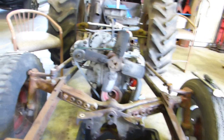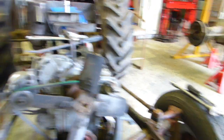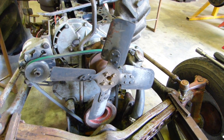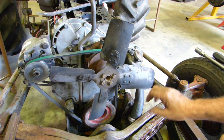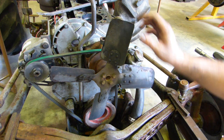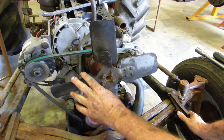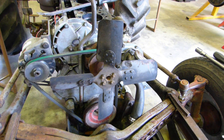Well that brings us into the water pump. We'll come in a bit closer here and try to line you up a bit better. Now this water pump has a couple of lock tabs folded over here to hold the fan on, and it's a trapezoid pattern. A trapezoid pattern means that these two bolts here are closer together than those two there, so it's not a square.